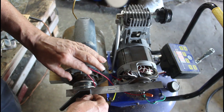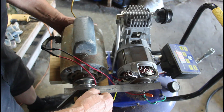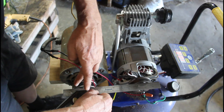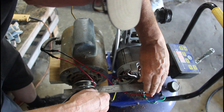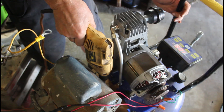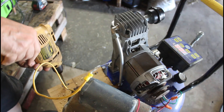Here's how you align the pulleys. This one is fastened down. I've got to come back a little bit, so I move the motor back just a little bit. I moved it way too much. Make sure that it's touching here and here, and then here and here. You can also move the pulley a little bit.